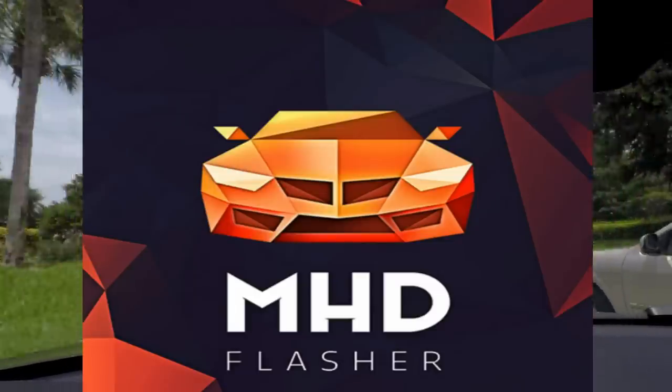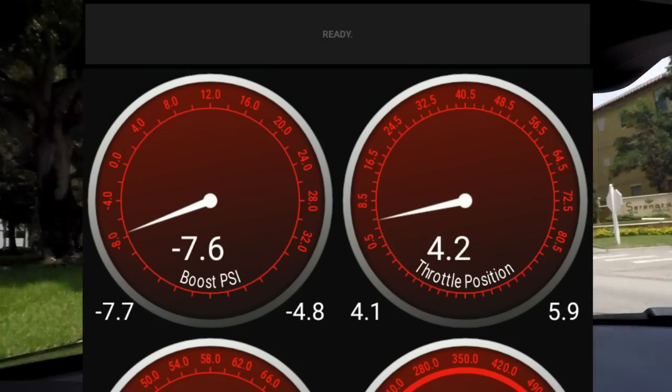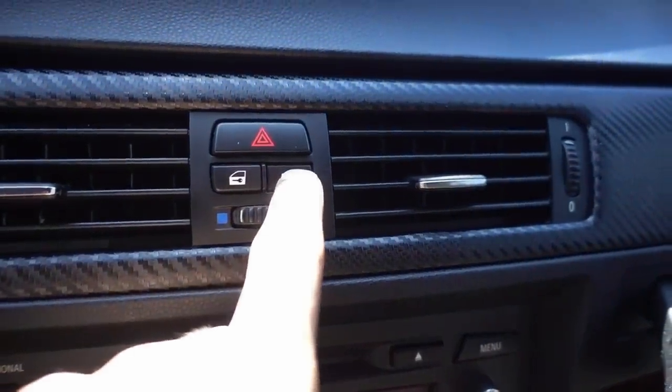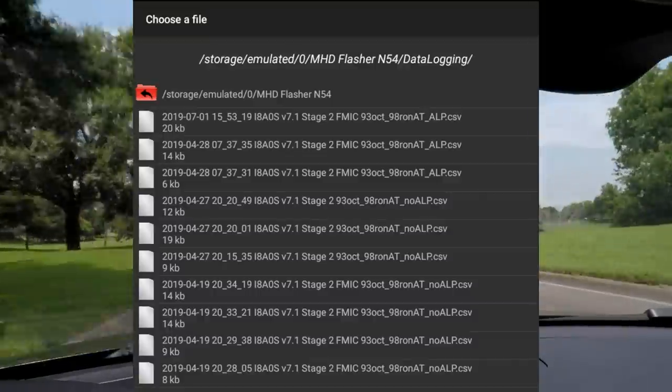So here's how you get a CSV file using MHD. Once you're at the main menu, all you have to do is navigate to the monitor tab and select either manual log or auto log. Manual allows you to control when MHD starts data logging, and auto starts logging once it detects throttle input at 60% or more. For this example, I'll be using auto logging for ease of use. Now go back to MHD and under the monitor tab, select 'Graph a Log' and you should see a newly generated CSV file. And that's it — now I have a CSV data log. I just have to open it up on Log Dyno, put in my vehicle information, and we'll get a reading on how much power my car makes.